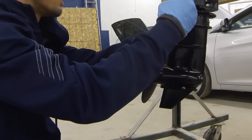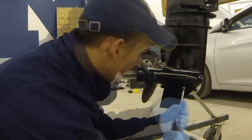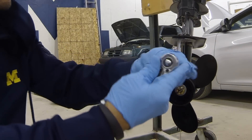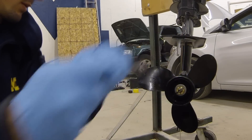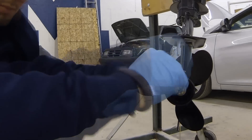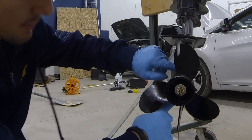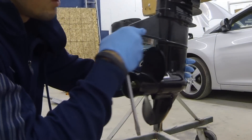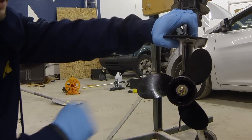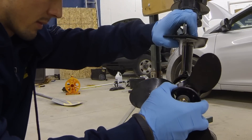The first thing we're going to do is drain the oil out of the gear case, just so it's a little less messy when we open up the back seal. We'll take a 10mm socket and break free both of these bolts. It helps to start with this in neutral — not mandatory, but it does help. Now we've got both bolts broken free. We'll take a flathead screwdriver, wedge it in the side of the seal — that breaks the seal free. If you're in salt water it might take a little more prying and soaking with penetrating lubricant. We'll just wiggle this on back, and there we are.